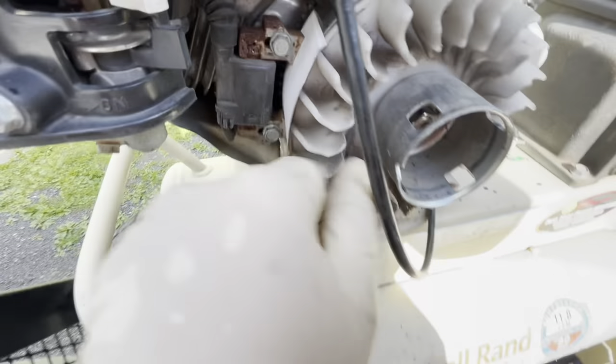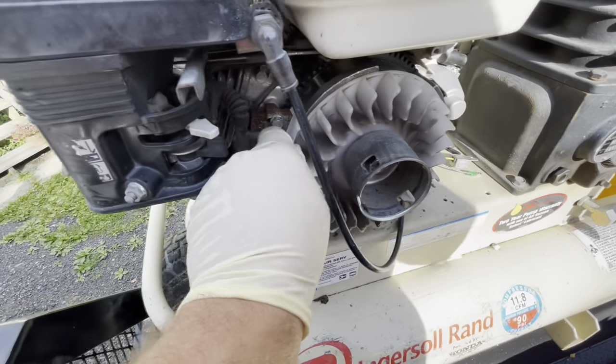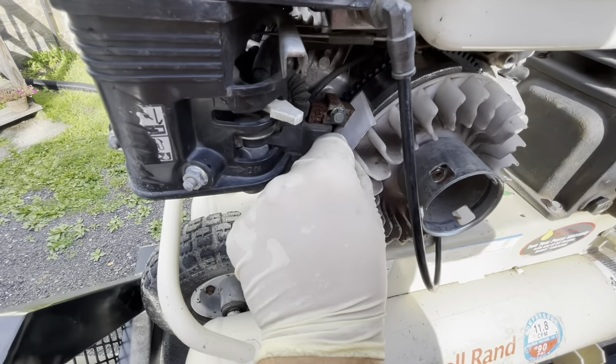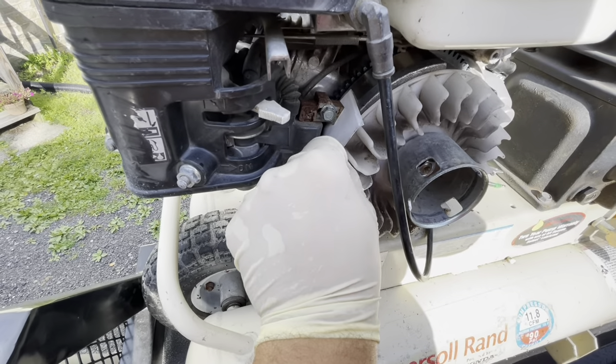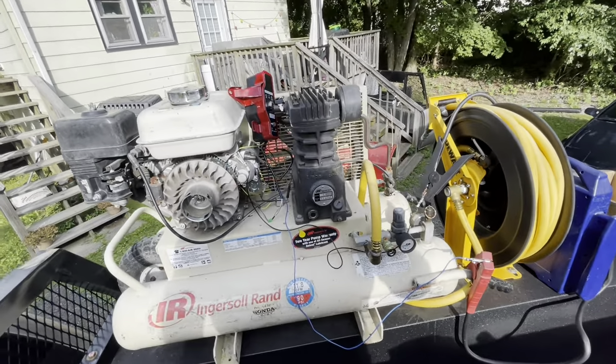You just want to take a business card after you get this tightened down. Lined it all up, tightened it down with the impact gun. It's supposed to use a feeler gauge, but a business card works. That's tight already — just test right at this to be sure.